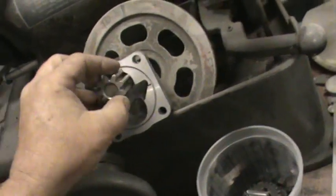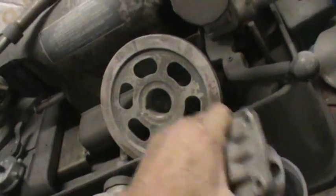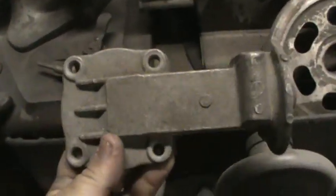The other way, which I don't condone or like, is a filter pump, which would be one of these jobbers. It would go on the pump sort of like this, and it sits under the car, and the oil filter's right up against the header there, heating the oil up all the time. So that's why I don't like those. And there's something EMPI shouldn't make for engines, and one of those is an oil pump. So with that being said, that's why I don't run a filter pump.